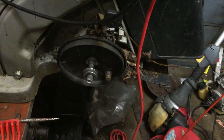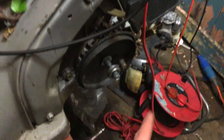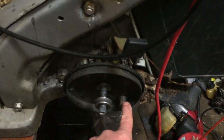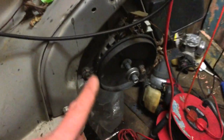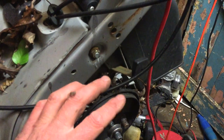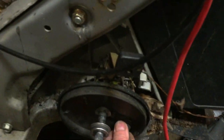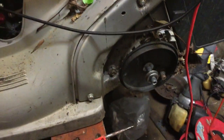I have put a video up about this — I had to do a little conversion and drill the shaft on the other side to stop it slipping through. That was on one of my HRXs and it's still going well to this day. They kept pinging through and pulling off that circlip, so on this one I might have to do that as well. There's a nice little metal bit where you can put a washer and then a split pin — you drill a hole through and put a split pin in and it stops it moving.